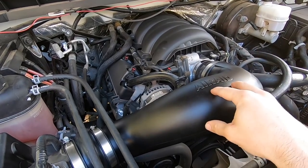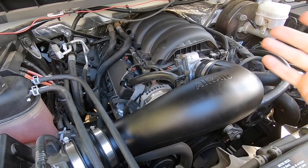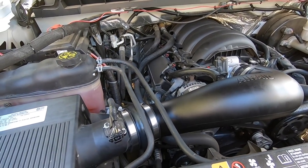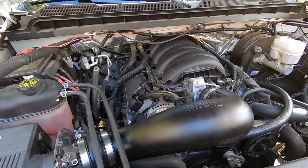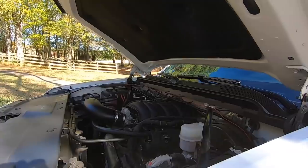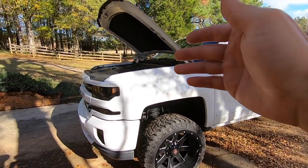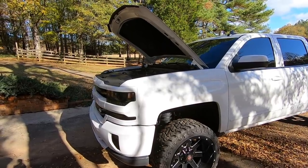I don't really see how we couldn't have some better flow with this box rather than the stock one, because we don't have that huge muffler thing on there. I'm sure there's plenty of people in the comments calling it something different and saying it's dumb to do this, that you should do an open filter and that the heat doesn't hurt it. But that's how I feel about it, and it's my truck. My buddy John Wargo did a cold air intake with an open box and he definitely noticed a lot of extra heat after installing it rather than the factory box — so you really just don't want that. Doesn't void anything — if we need warranty work, I'll just swap the factory box back on.